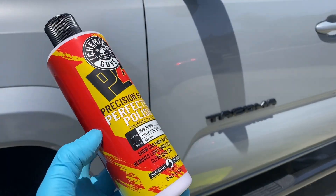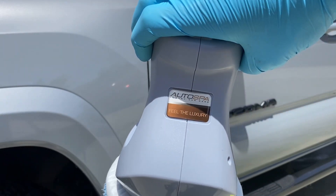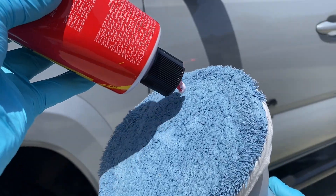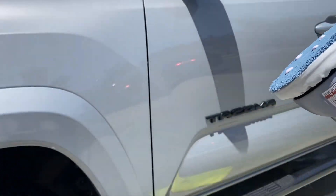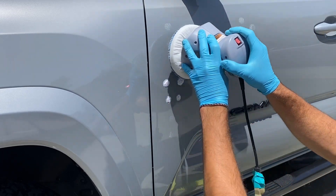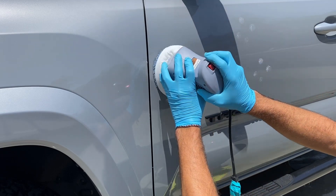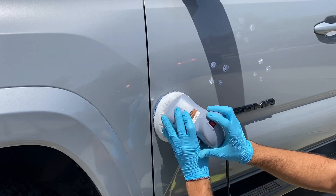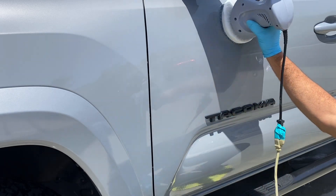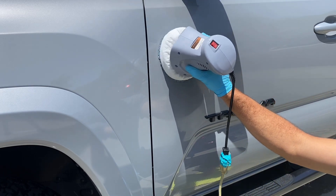Because my truck doesn't have any deep scratches, I'm only using this polish from Chemical Guys — it works very well — and I'm also using a $20 buffer from Walmart. There are a lot better ones out there but mine didn't have any severe scratches. You want to put a couple of little dots, add more as needed, press it on the truck in different areas, then turn on the machine and only do a little section at a time — maybe two feet by two feet — going back and forth. Make sure you read your instructions because every product is different. Mine said to buff until the hazing almost disappears. I added more product to one section where I hadn't put enough, but always read and follow your directions.